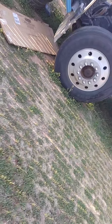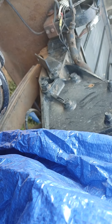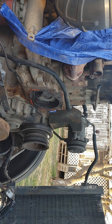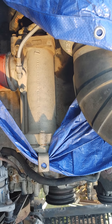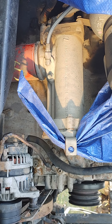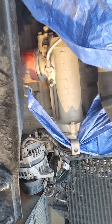With that being said, you have to get a new after-cooler. You've got to change the radiator, take the water pump off, take the clutch fan off, take the thermostat housing off. I'm also switching the oil cooler because I have this single-filter style, which was very popular on the low flow. I'm going to the one that has a 777 and a 670 filter — it's the double filter. Then you've got to take off the water manifold.